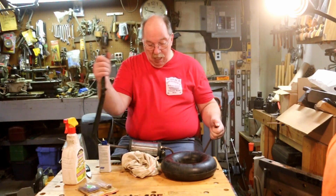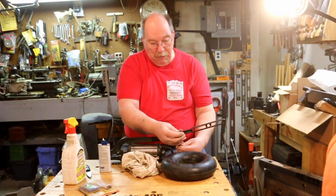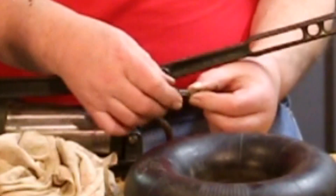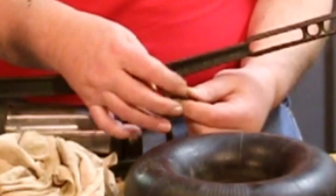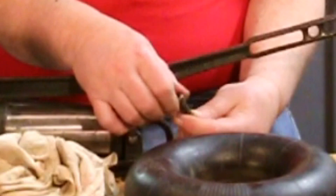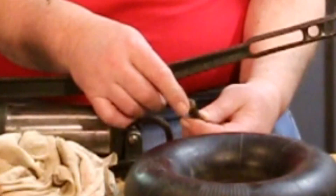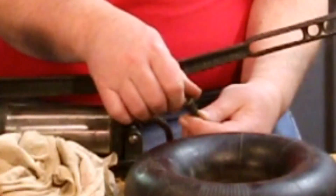In the meantime, this thing is working just fine. But there's a flaw — I need to make something that I can press against it, bump it up and then pull it off quickly. If it takes more than just a couple of seconds, during that time the Schrader valve is open on the valve stem and this little thing doesn't hold air at all. It's never designed to hold air; it's designed to spin on easily and take it on up. I'm thinking this little tube doesn't have enough capacity to hold enough air, so it can leak down like 1 or 2%. On a car tire this probably wouldn't leak an appreciable amount of air — you can over-inflate the tire and then quickly spin this off.